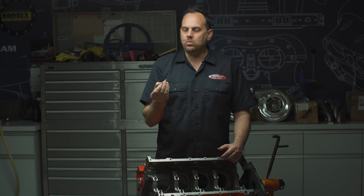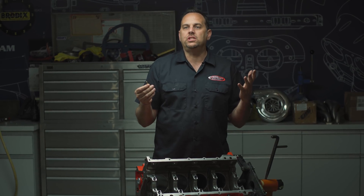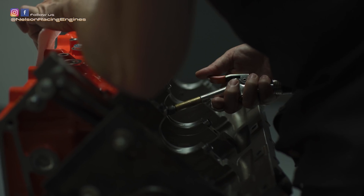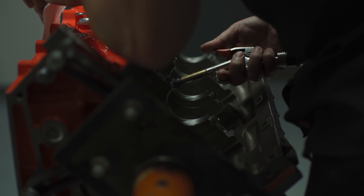When that piston is sitting there glowing red with 1,400 degree combustion temperatures on the top of the piston and it's going to be doing that for a half an hour, we're going to shoot oil on the bottom of the piston to cool it down and try to keep it alive. I'll show you an example by taking a piece of paper and airing it through that jet so you can get an idea of how it works. I'm going to put the air gun in the actual jet, turn the air on, and you'll see the air shooting the paper up — simulating the oil that's going to be spraying on the piston to cool it down.